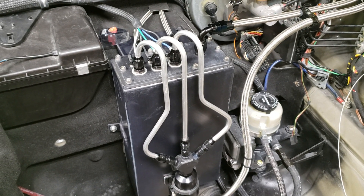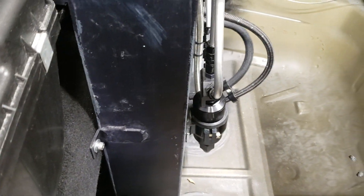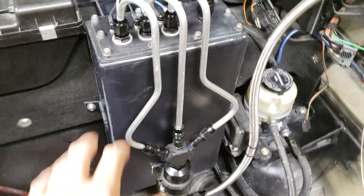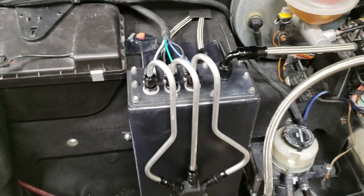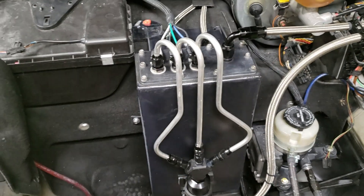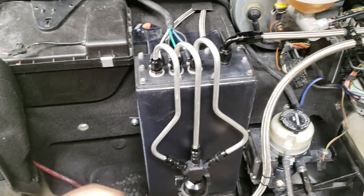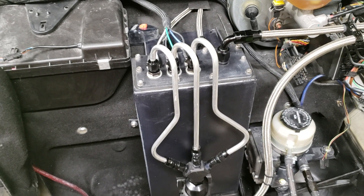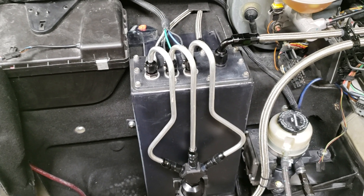The other funny thing I did that set me back — you may be able to see how this tab is now bent, and this surface right here is actually bowed out a little bit. This tank should have zero pressure; it's just a surge tank. The factory tank fills this, there's a return line that goes back to the tank, and it never builds any pressure. All the big pumps are in here so they can't starve. Well, I'm an idiot — I didn't realize that on my 911 build I had a return-style fuel system, and I assumed this was the same. Turns out the return line was actually the EVAP line, so I wasn't getting a return.